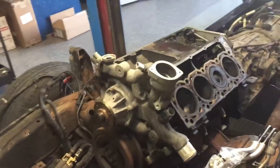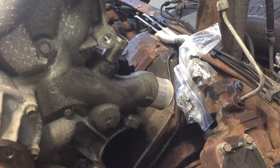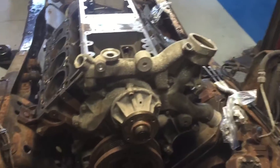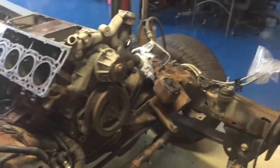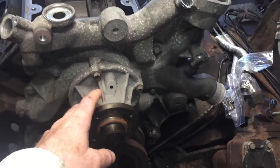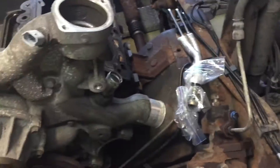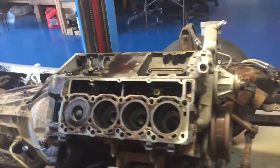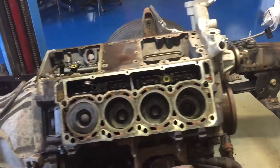Remember, we're going lifters. It is an 04 engine — it's got the four o'clock position lower rad hose outlet, but I'm positive it has a 100 millimeter coolant pump, so we won't pick on the front cover. A lot of early 03s will have a 90 millimeter coolant pump, and a good indication is a press-in coolant Y-pipe flange at the four o'clock position front cover. But this is an 04 engine in an 05 Excursion — I'd put money on it that it's a 100 millimeter pump.